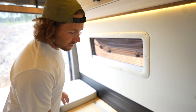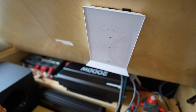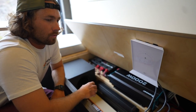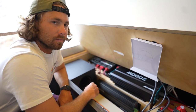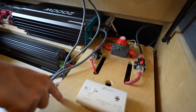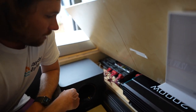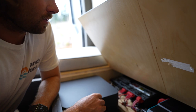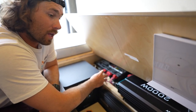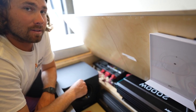Now I'm going to show you the guts of the system. Starting at the top right here we have the Starlink module — you can also use Bluetooth to your phone with an app that shows all the different Starlink settings when you set it up on your roof. It'll calibrate itself to the perfect position and get your internet within a couple minutes. Over on this side we have a battery underneath this compartment — a 200-amp-hour and another 200-amp-hour, giving you 400 amp hours of capacity. Coming over to this little area, the Redarc vehicle management system is where all of your electrical inside the entire van comes in and out: all your lights, water tank, you can see how much water you have left in your tanks, and everything runs up to the display module where you can Bluetooth to connect to anything in your van.